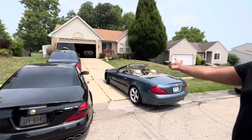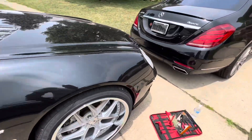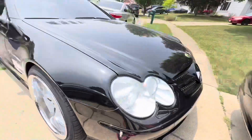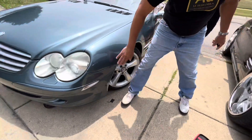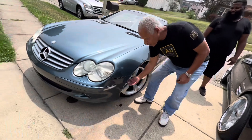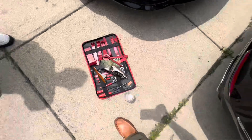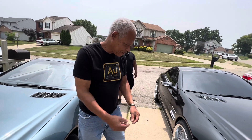I'm teaching him how to take his side lights out of his front fender. He gave me a little tip: instead of removing the inner wheel well, you have to be careful — typically the back of them do break because they're just old. I take these out all the time. Did you go through the wheel well or just pop them from the outside? I went through the wheel well. That's the proper way of doing it, because you can break them if you try to pop them from the outside. I have plastic tools that help, but if you use a flathead screwdriver you'll scratch them up.